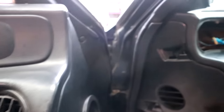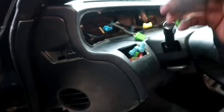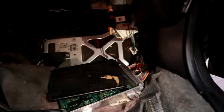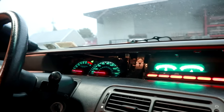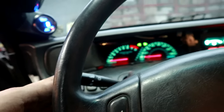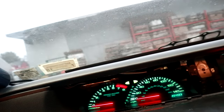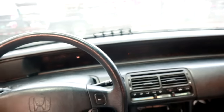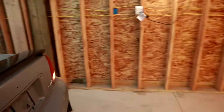Out with the old and in with the new. You shove it down here, pull this out, pull everything down, and then these all go to the switches on that little thing. Now I'm going to put the cluster in. One thing I have to mention - I can't find anywhere to plug that last connector in, but in theory the dash should light up when I turn the key. I bet that connector is for the blinkers because those indicator lights aren't supposed to stay lit up. There we go - dash is back together with the new tweeter covers. Look how much cleaner that is. They blink correctly but they blink fast and I can't get them to blink slow even with resistors.